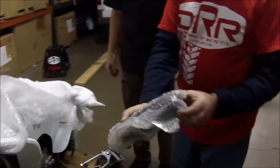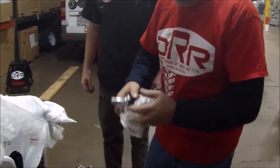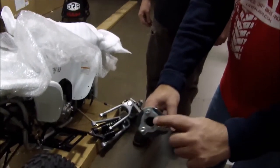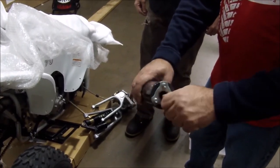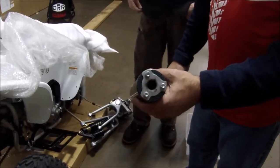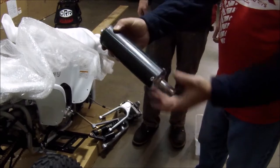We've removed our silencer from the package. Nice looking faux carbon fiber. It already has the bolts inside with the Allens. And if you look inside, this is the US spark arrestor. So as you build it, you'll know exactly where the spark arrestor is mounted and stored, because you need to clean that at least every two to three weeks — maybe more with heavy use. Whether you use good oil or bad oil, it's going to clog up.